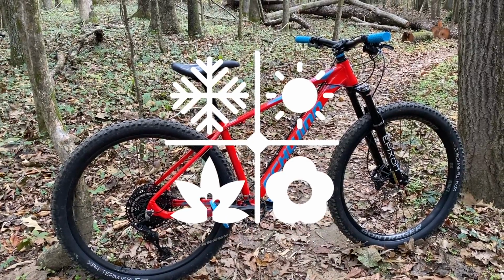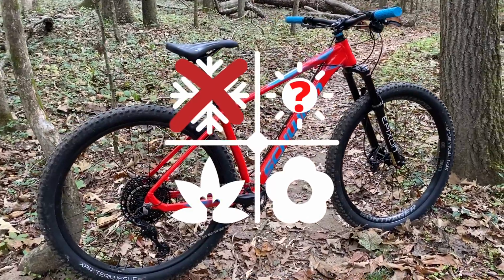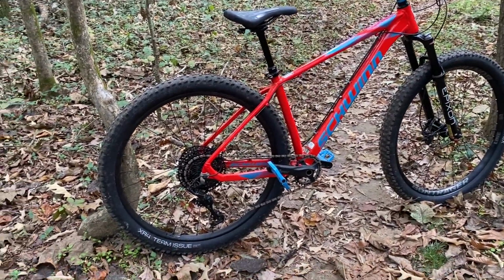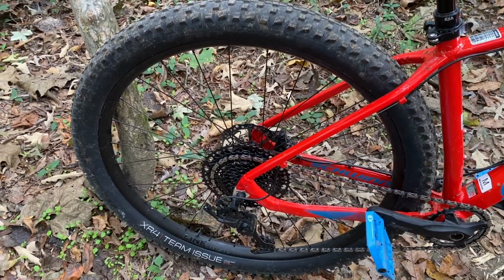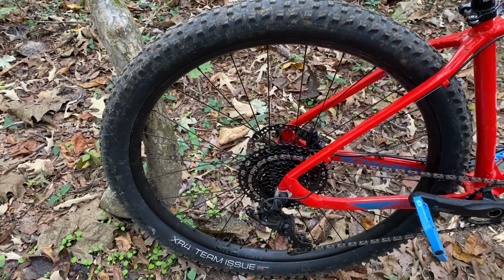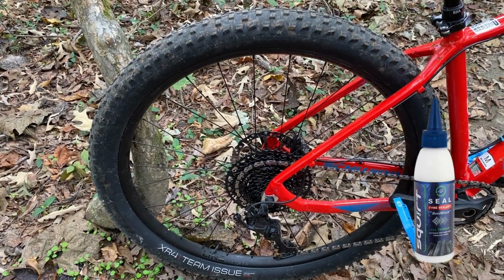They're going to park it when it gets ultra hot, or definitely park it during the winter months in the garage, maybe just a tarp thrown over it, whatever the case. And in those 3 or 4 months when someone's not riding, the tires are going to go flat. That even happens with tubeless. The difference is when it goes flat on a tubed wheel, you just air it back up. If a tubeless setup has gone flat and stayed that way for a few months, you're going to need to put new sealant in there, and that's a whole new ordeal.